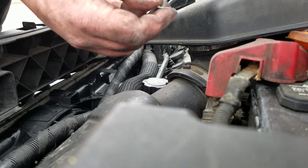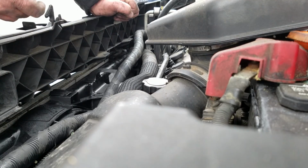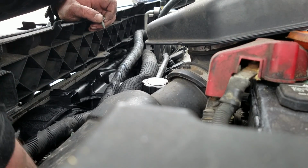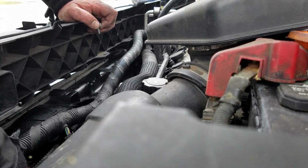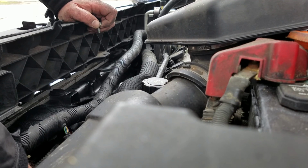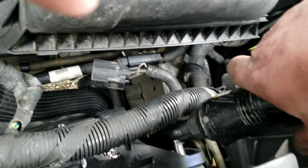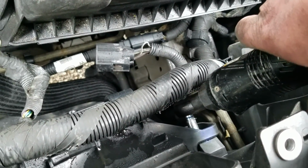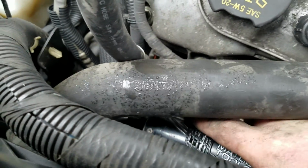We're gonna go back with these screws. Go ahead and get it tightened up. Starting them up with your finger first would probably be my best recommendation. Get them started with your fingers. So I got both my bolts started. One of them's right here. And these do not need to be really tight because it's plastic, so you'll just break them. You know, don't want to do that.